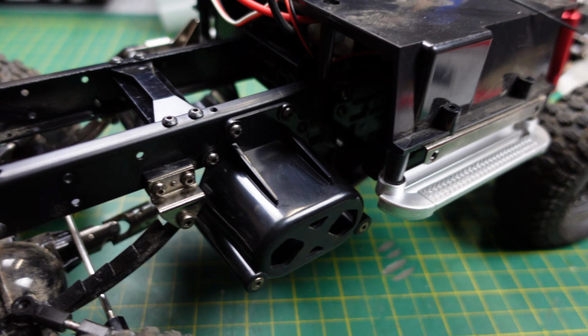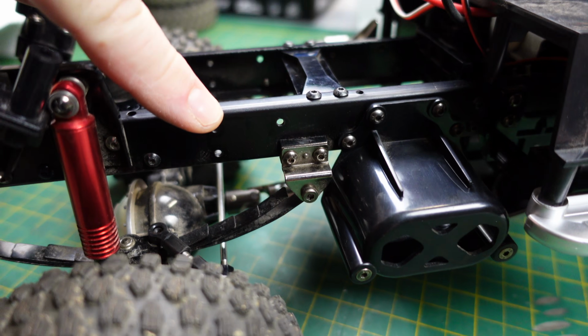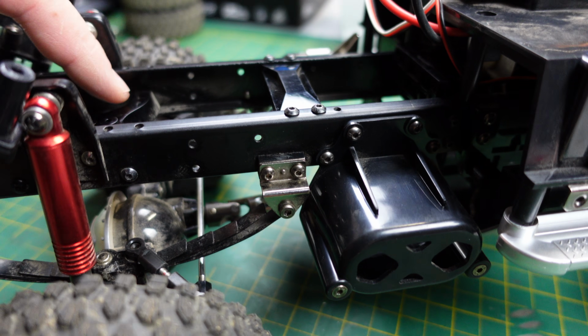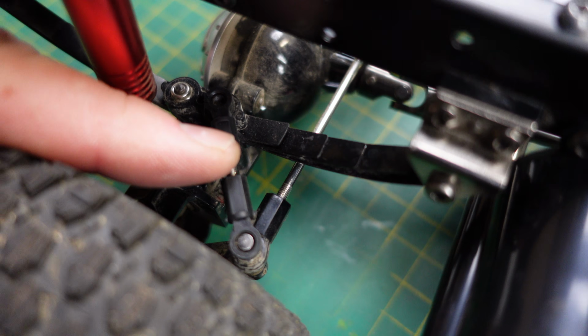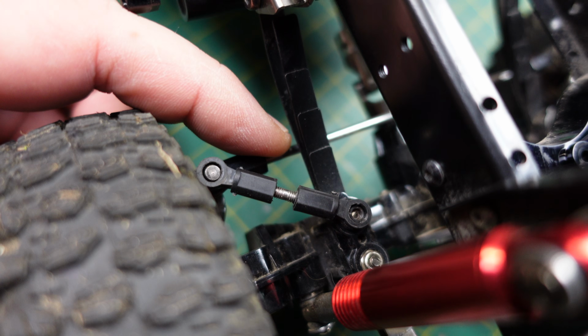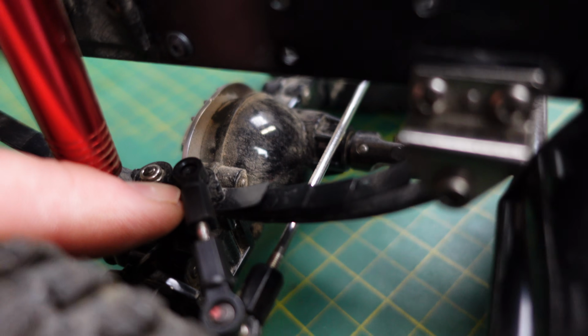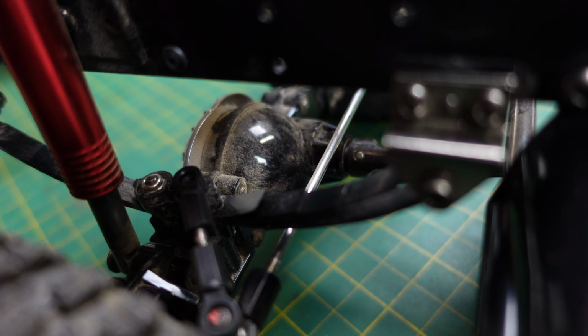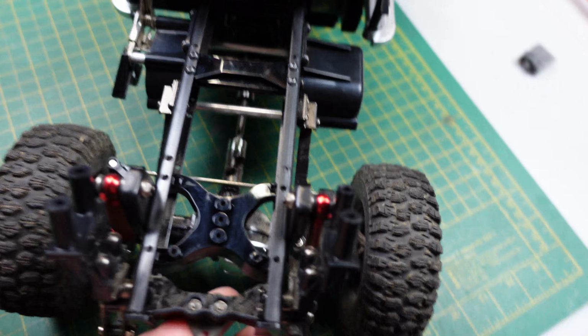And then for the removal of the 4-wheel steer, get rid of the servo in there, and the pivot bracket with the links on it. You get these two little links in the box, one there, one on the other side. They clip onto the top of the leaf spring there. There's a little ball connector, clip it on there, and clip it onto the rear wheels.